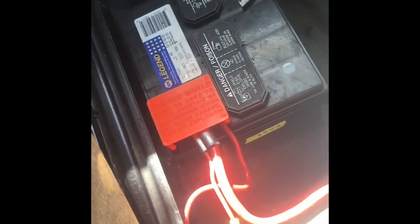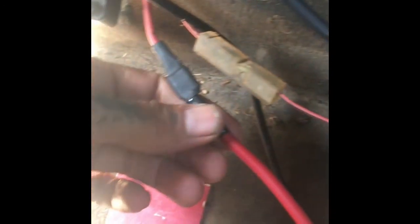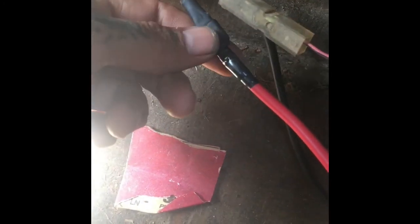And the reason why I did this, okay, wait, this one here goes down to the starter, plugs into the starter, right next to the positive cable that bolts on into the starter. So people will know what this wire goes to. It's a red wire with 2 black lines on it. I couldn't find a replacement wire with 2 black lines on it, so I just kept it open so we could tell. And these ones are red wires with white lines on it. Well, one is. This one is a red wire.